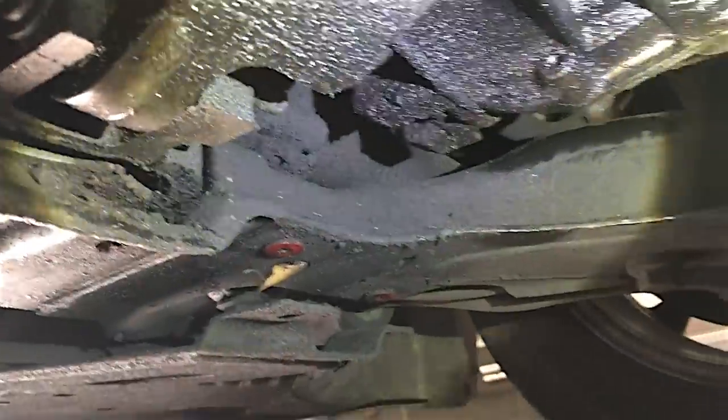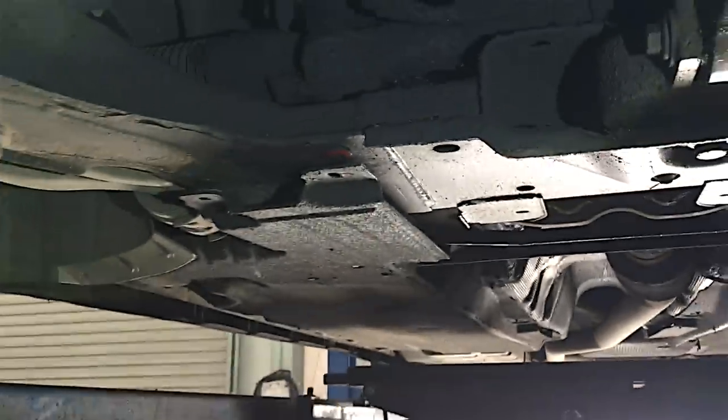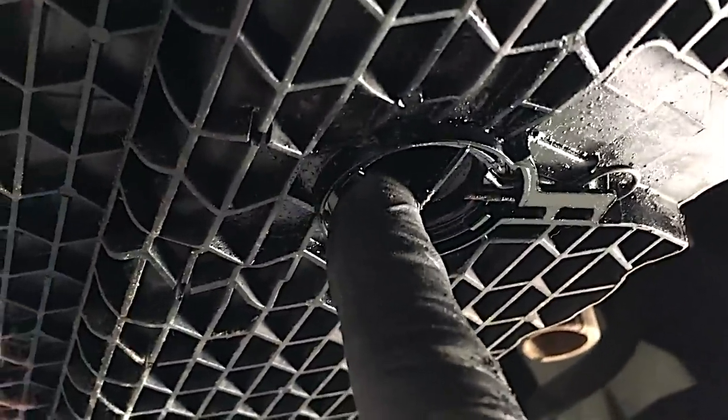Right, we'll carry on. So basically it's just a visual examination. There isn't actually much to do under here. The oil and filter is the main thing. So I'll drain the oil anyway, because you've got your pin there you pull out and undo, and drain your oil through that sump bung, you just twist it 90 degrees. And I've changed the filter.